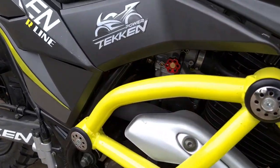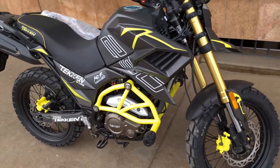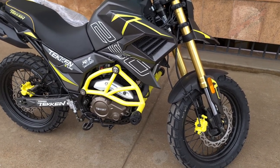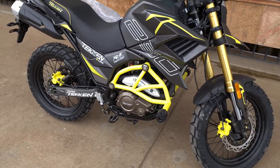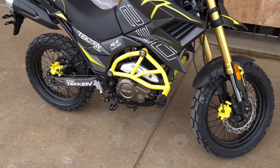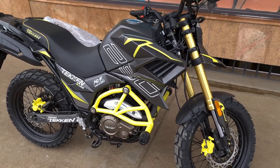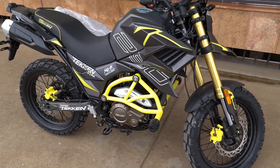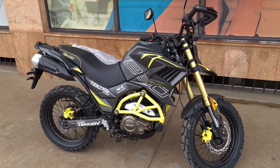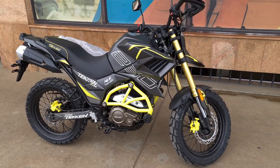They have a nice PZ30 carburetor. This PZ30 carburetor is, I'd say, the closest carburetor to EFI. It's one-click start, and it's smooth. I love its smoothness. This engine is quite powerful. The bike as a whole weighs 140 kgs, and the engine torque output is 17 newton meters. So you can imagine, this is wheelie type torque because the weight to torque ratio is quite big. I've heard of a couple of clients saying they mistakenly did wheelies on this thing. It's good if you want to get out of those hard, muddy roads and climb up those steep hills. It's quite perfect.